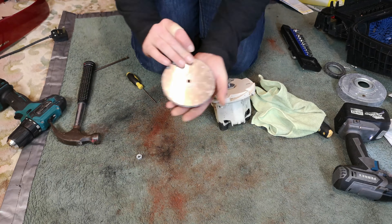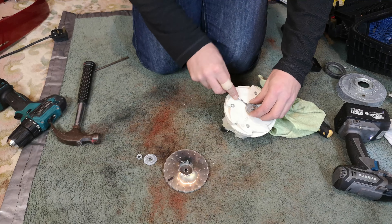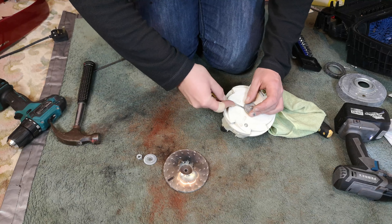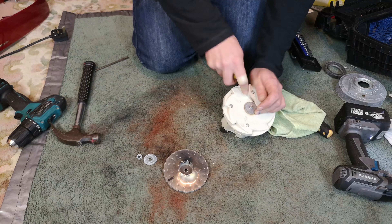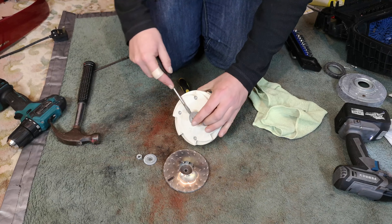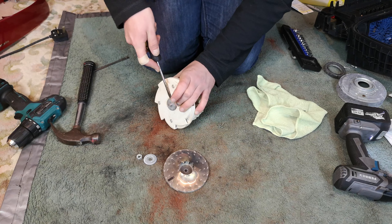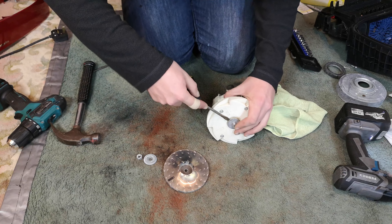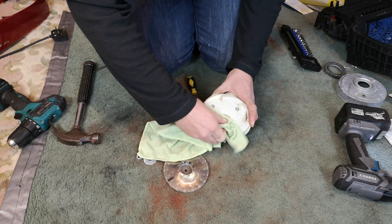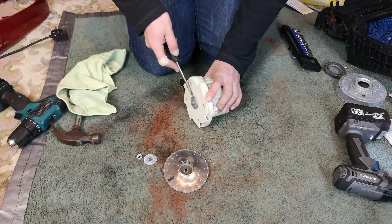Nut, washer, fan - and then, are you going to come off nicely, or are you going to have corroded in and bring the motor housing apart with you, and bring this video to an abrupt end as I write off a Miele? Of course you're not. You've just got to lever this off, because it's a very tight fit anyway. Again it's quite corroded. I'm almost going to barely pull on it, but it is walking up slowly.